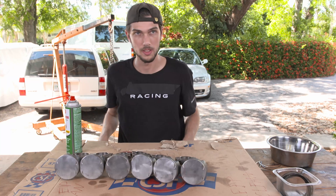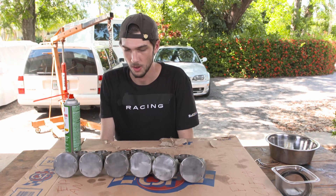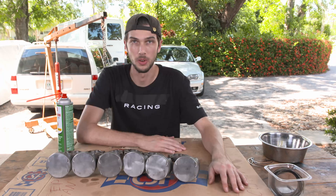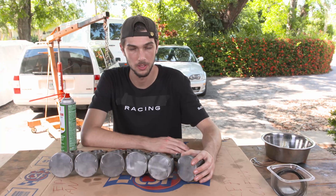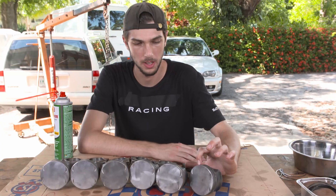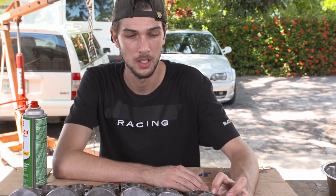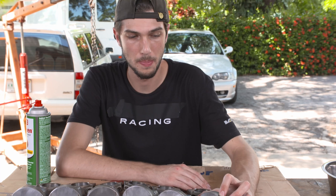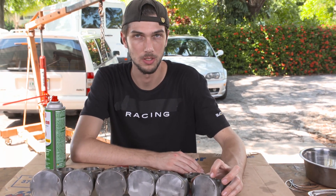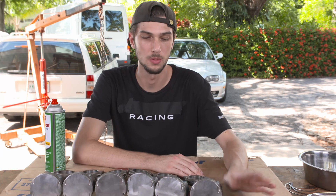I think that marks the point where we can file our rings. I'm going to go get the block, put it up here, go get the rings, and start getting that all sorted. I have a bad feeling about the rings — when I was looking at them the other day they felt a little thicker than they should be, and on the box it said M57 diesel. Based on my own intuition, I would think diesel rings would be a bit thicker than petrol rings. So let me go grab those, size them up, and if they're good I'll get the block out too.